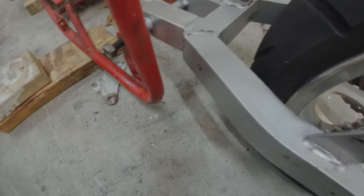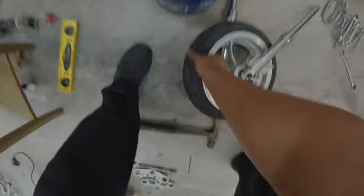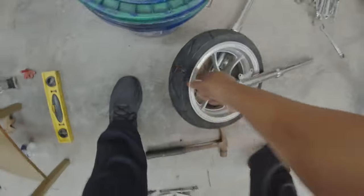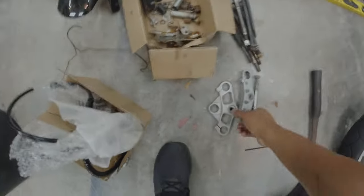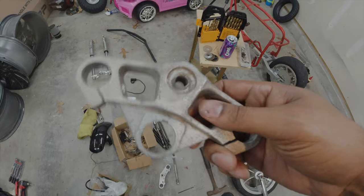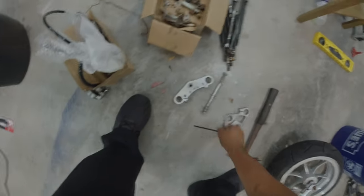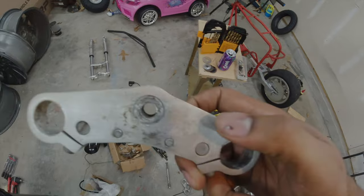For right now the swing arm is just soft mounted, so that's good for now. Next, I'm switching from the no-suspension front forks to some 49cc front forks. These wheels barely fit in here. The triple trees are off because the top triple tree doesn't have any room to mount handlebars — no big holes in it. So my idea is to move the top triple tree to the bottom, move the bottom triple tree to the top, and then there's all that space to mount handlebars. I was like, hmm, can I actually mount handlebars on there?